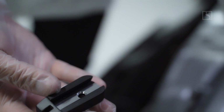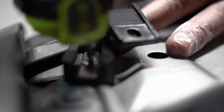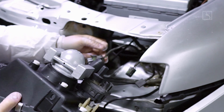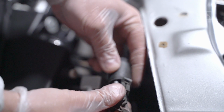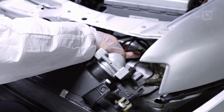Step 7. Install the fender side top tab holder and inner top side plastic inserts, but do not use yet top sliders. Step 8. Insert headlights in place. Connect back all the electrical harness connectors in the reverse order as they were disassembled.